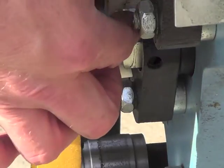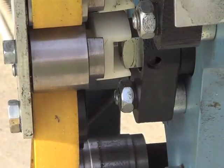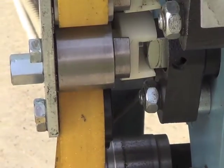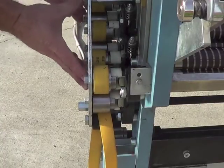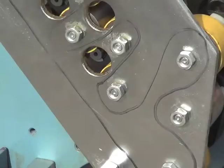Get the plate started on. It can help to pull the coupler and get it started into the female part of it. Do that with each one at the bottom. Once you get enough of the screw started at the bottom, put the nut on to hold your plate. Once you have all the couplings just started inside the female part, the whole thing should slide together. With the coupling plate mounted in, please note the path of the serpentine belt that we drew on earlier becomes very important at this point.